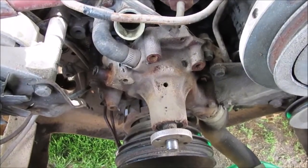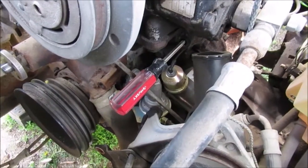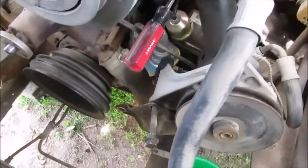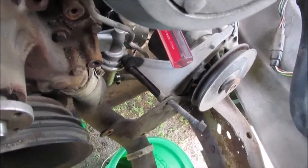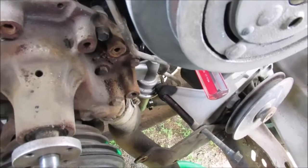I'll make a cardboard template and show you where the bolts are at — there goes the whistle, we're gonna stop recording. See where the screwdriver's stuck? That's the long bolt on the power steering pump. The other two holes are both right into the water pump. Remember, you got a short one behind the pulley for the adjuster — two different lengths so you can fit it in there with the pulley in the way.